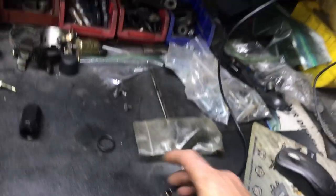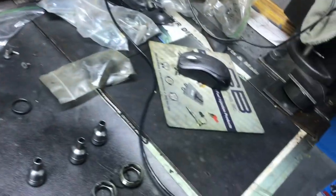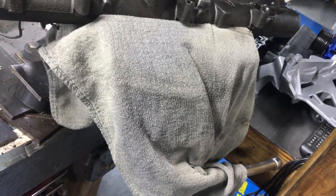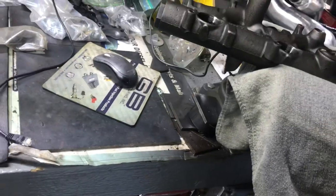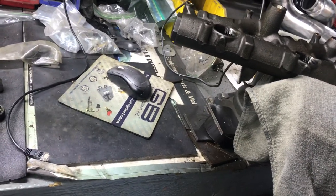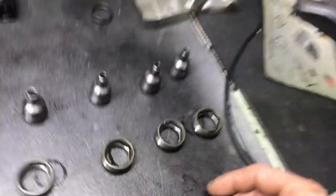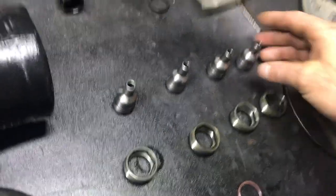I've used Mark and Cory's HHC Diesel nipple cups, but mainly on '03s. For this one, we just need to put some factory nipple cups back in it, so it snaps on to the injectors. I want it to pop on — I can't explain how it feels, you just got to feel it. It's got to just go on. When I put that one on it did not feel like that, so I took it back off. I'm going to go find a set of nipple cups and put different ones on it — go back to stock. Stock ones work.